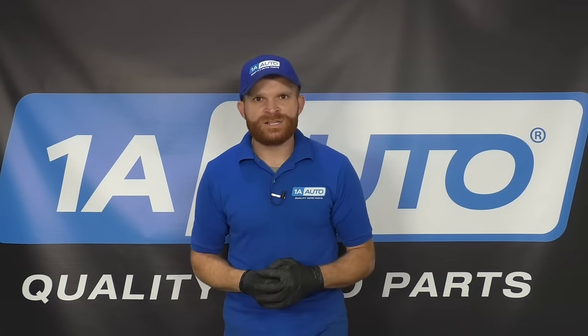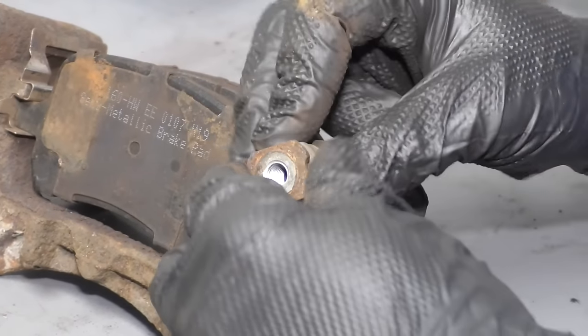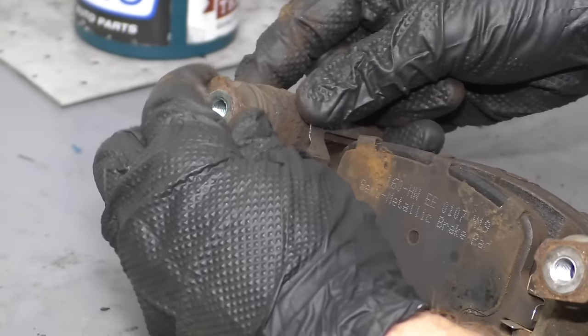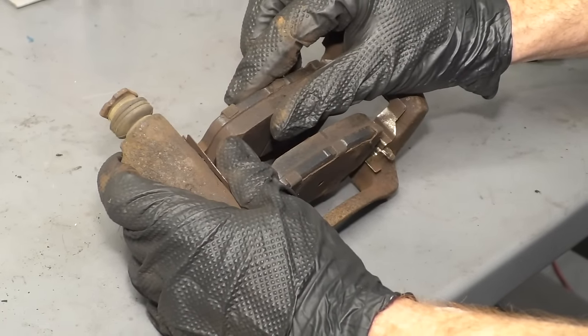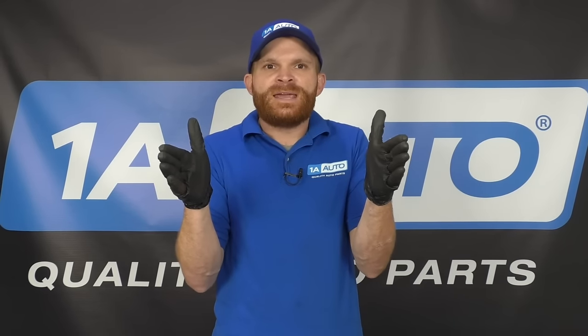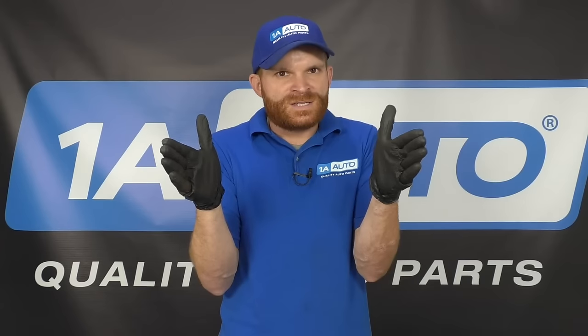Something important to remember is that the rotor showing the issue might not actually be the cause of the issue. There are a whole bunch of things that could cause an overheating condition. I would think about checking those brake calipers - and I don't mean just pushing back the piston. If the piston's not functioning as it should, it's not going to be able to release the pads from the rotor and of course you're going to have an overheat condition. You also need to check those sliders - that's the part where the caliper connects onto the bracket. They need to be able to move in and out easily. If they're not lubricated or they're seizing up, that's going to cause an issue. You might also notice that your brake pads are frozen inside your caliper brackets due to rust buildup, making it so the pads can't release from the rotor, causing constant pressure and heat.